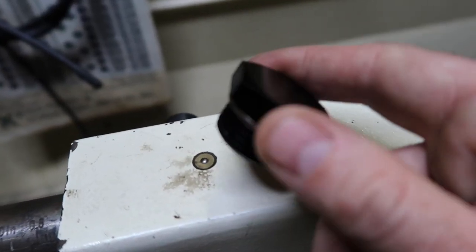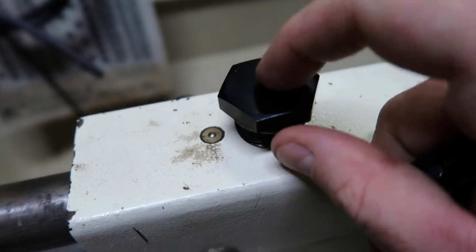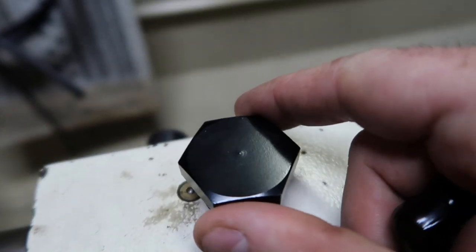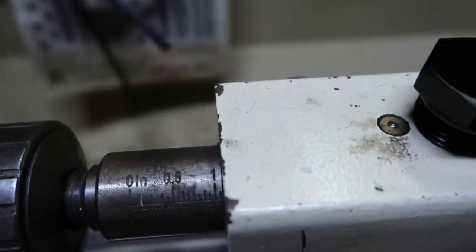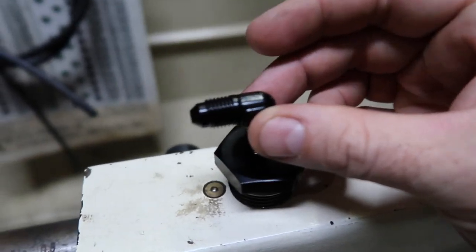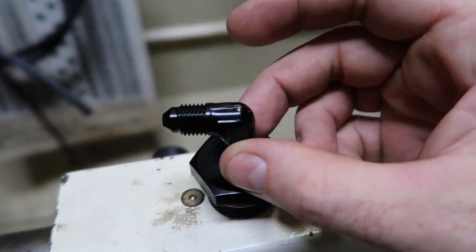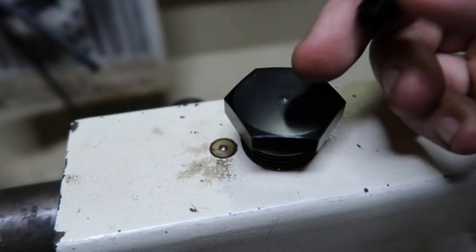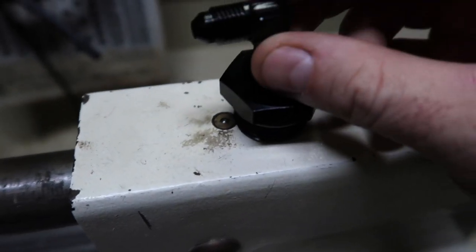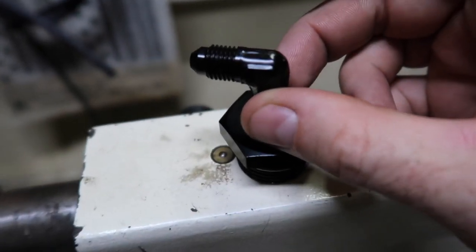This is my dash-12 O-ring plug. Instead of using an internal hex plug, I opted for the big external hex style so that I can drill and tap the center of it. What I'm going to do is thread this in there, and that'll be the source for my crankcase pressure. I'm just going to put this in the lathe, drill it and tap it, and then I'll be able to thread this in there nice and easy.